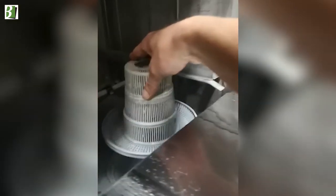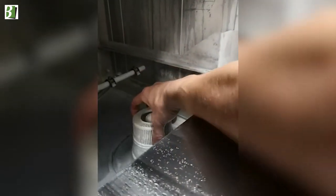You can shut the door — that won't change anything. It will drain down, the pump will run for three minutes and then stop. When the machine is empty, twist to the left and lift out the filter. You'll notice there's a lug at the top and a lug at the bottom — one lug at 12 o'clock and one lug at 6 o'clock — and there's a locating hole for it in there.